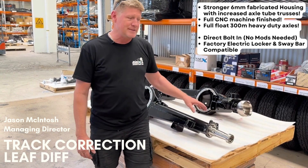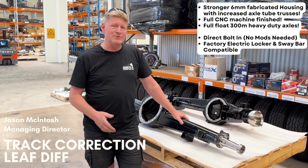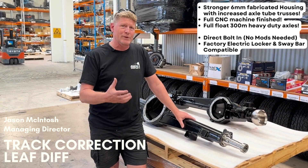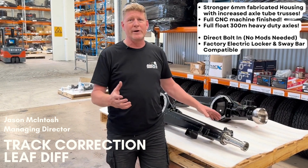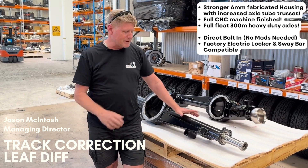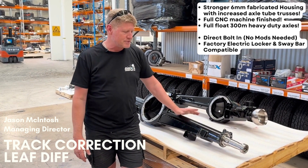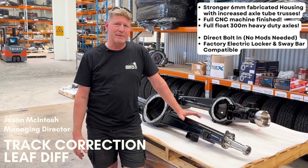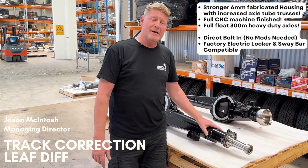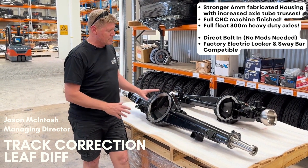Adding a machined hub and then adding a wheel is exactly the same process — it's putting excessive stress on your wheel bearings. As a company that does thousands of GVMs on these cars, at 20,000 kilometres you must service your wheel bearings — that's how important your wheel bearing setup is. Having the right rim and tyre combination matters. If you want to widen your track, the correct way to do it is with a housing. J-Max are the largest manufacturer of aftermarket differentials for Land Cruisers, supplying these all over the world into armored vehicles, service vehicles, and the retail recreational sector.